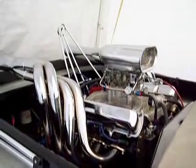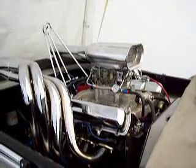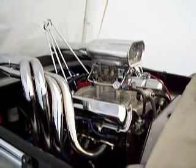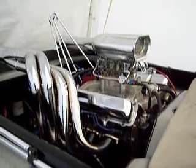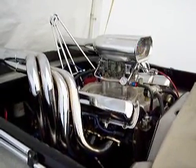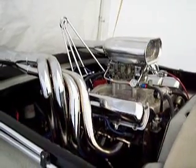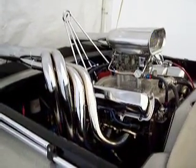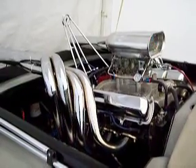Basically, the function is to relieve the water pressure that builds up inside your engine. In many of the older jet boats, you'll find there have been many issues with it blowing freeze plugs, blowing intake manifold gaskets, blowing head gaskets, etc. What we've done is designed our own water pressure relief valve system to relieve the pressure in the engine so that that doesn't occur.